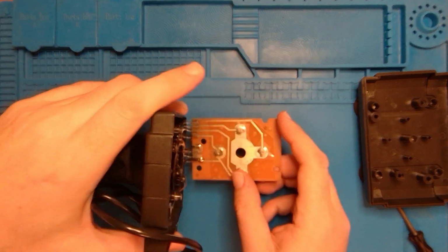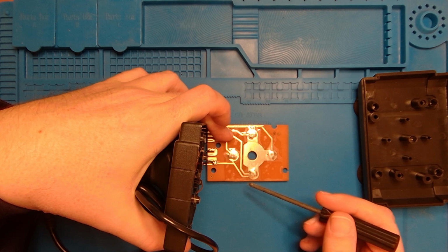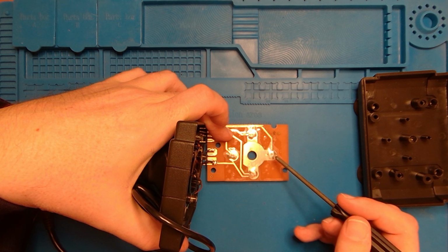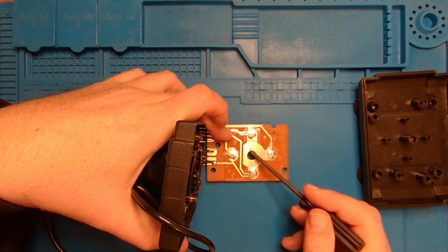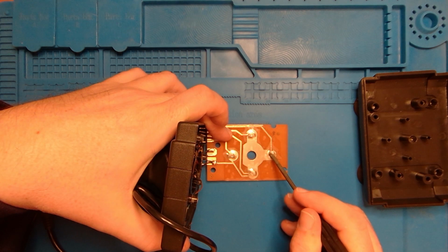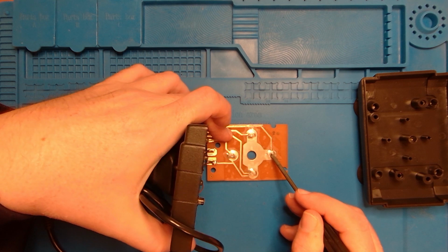Okay, yeah, I've seen this kind of joystick before. Very, very simple dome switch arrangement here. Very similar, in fact, to the Atari 2600 joystick. So what you've got is an outer bit, presumably ground, here, which surrounds the outside of these switches. And when you click down on the dome, it makes a connection between this and the track to close the switch.